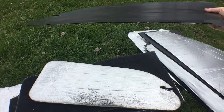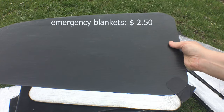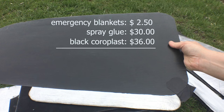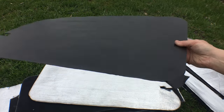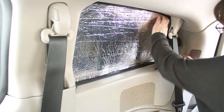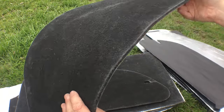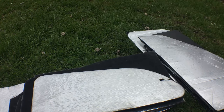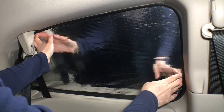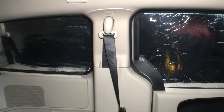I made these for our trip last summer. They are lighter to handle, easier to store, completely waterproof, and have held up well so far. I bought the emergency blankets as a pack of 10 and they worked out to about $1.25 each — I may have used two or three to do the whole set. Plus I used more spray glue since I was doing both sides, so maybe two cans. The coroplast itself was $36 for a 4x8 sheet of the black. The felt ones are like the Rolls Royce of window covers — the fit is smoother and they insulate better. But they're much bulkier, making them harder to store and manipulate. I consider them our winter covers — really early spring and late fall around here — and the coroplast covers are the summer ones. I hope this gives you a few options depending on your needs and budget. The cardboard ones are a great place to start, and the work is never lost because you can always use them as templates to make better ones when you're ready.